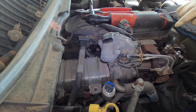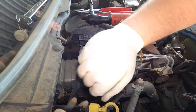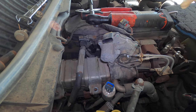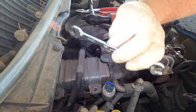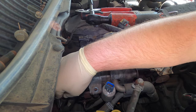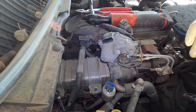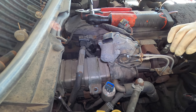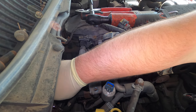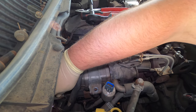What I mean by that is: this truck was in a front-end collision and the radiator's been replaced - I know because I tried to drain the coolant and it has an aftermarket radiator with a plug so tight I can't loosen it. That's what makes me think the EGR core is probably ruptured - whoever got in the collision may have continued to drive it with low coolant and actually caused the cooler to rupture. I always try to find the root cause of the problem instead of just fixing the symptom.